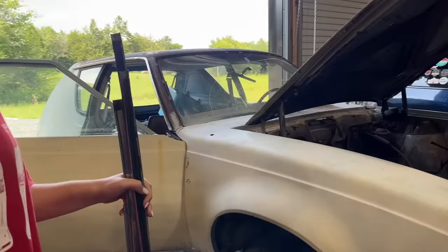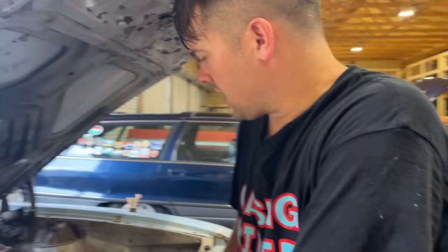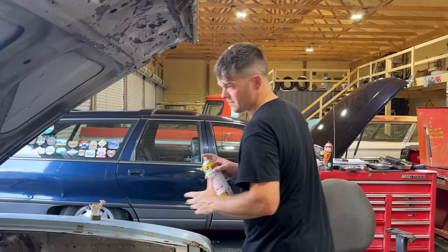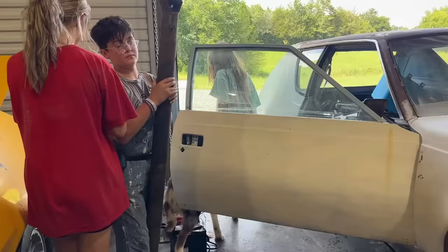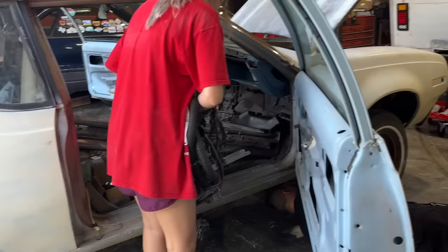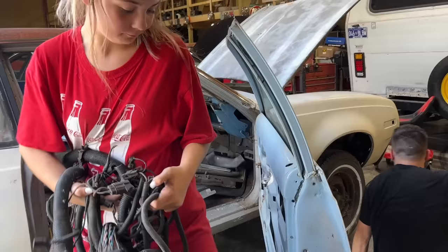The only thing we're going to do here is put front brakes on it. With a burnout car, there's no need for rear brakes — it just causes problems. We've got brand new calipers and hoses and an aftermarket master cylinder that only has a single reservoir because we don't need dual reservoirs. We're not doing rear brakes. We have a drive shaft — that's a good start.